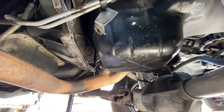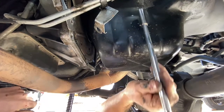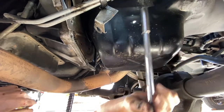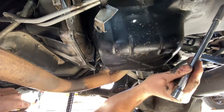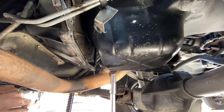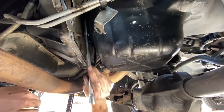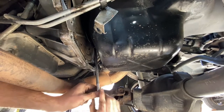There's different sizes to this oil pan. I keep saying pump pan. These are 7/16. Okay, so all the way around, pretty much on each side of the rail, 7/16 towards the front. I believe those are half, but we'll get to those. Up here, these are kind of a trick to get to. I think these are half as well, or if these were 7/16.